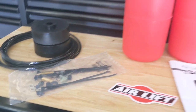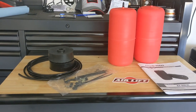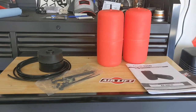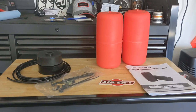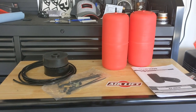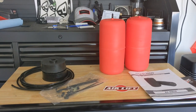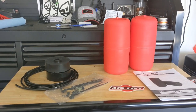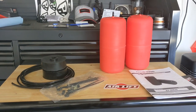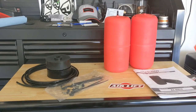We're going to get the Jeep prepped and jacked up, and I'm going to put the bags out in the sun so they get a little warm and are easy to compress and squeeze in. First I'll get the Jeep jacked up, then get the lines run where we need them — that way when the airbags go in, the lines will be there and we can connect them before we stick the bags in. Much easier that way.